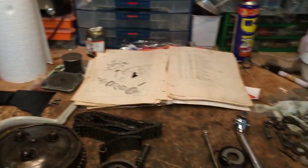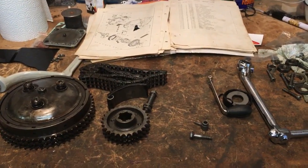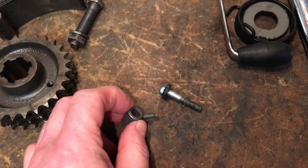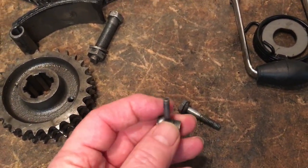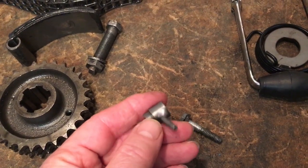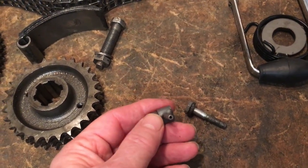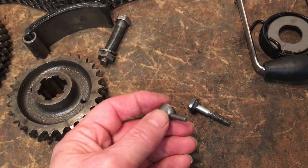Plenty to do. So back to the bike. Let's get it set up here. The first thing we're going to do is carry on where we left off and get the little chain oiler from the primary case installed. You remember last time we left it, one, we nearly forgot about this, but secondly, cleaning it up, we needed to get the actual drip hole cleaned out. It was absolutely clogged up, so I've had to buy one or two new drill bits of the right size. I opened it up first, cleaned it out with a 1mm, then a 1.5mm, then a 2mm diameter bit, and that's worked out really well.